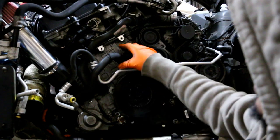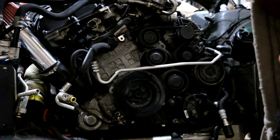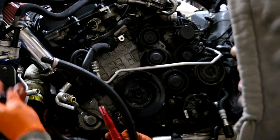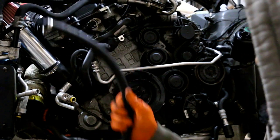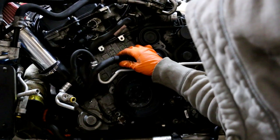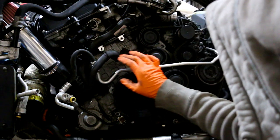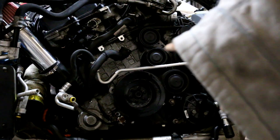This normally goes to the coolant reservoir, so now I'm going to extend the hose using a little coupler inside this hose right here. I'm gonna cut it right in the straight section and then run it alongside this AC line and connect it to the coolant.